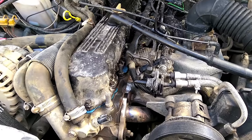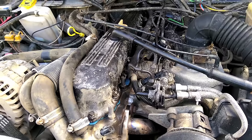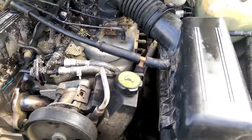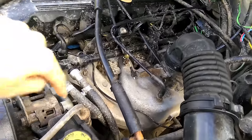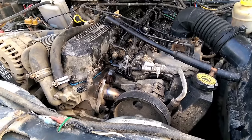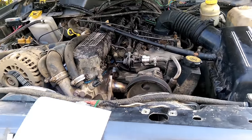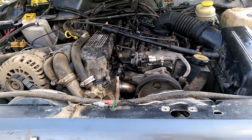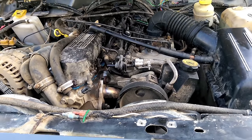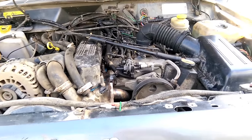That 0331 head is pretty close to the other heads, except it has smaller exhaust ports so they warm up faster, which doesn't help flow. So what Chrysler did to negate the loss of power is they made a curved intake runner — this one's all curvy and round, no square holes. This flows a whole lot more. With the combination of the 7120 head and the 99-up intake runner, you get a whole lot more power. Some people have seen up to 20 more horsepower out of the swap. You might notice it being smoother, maybe a little more all-around power.